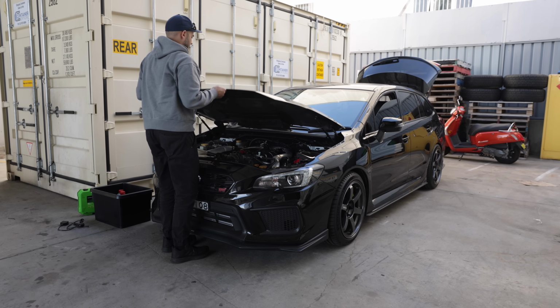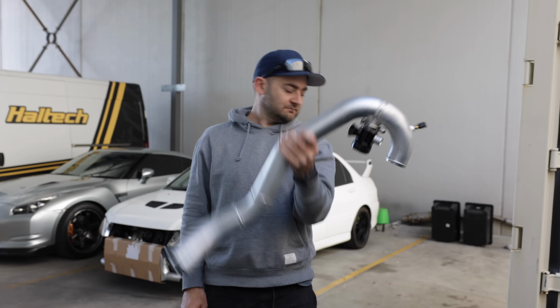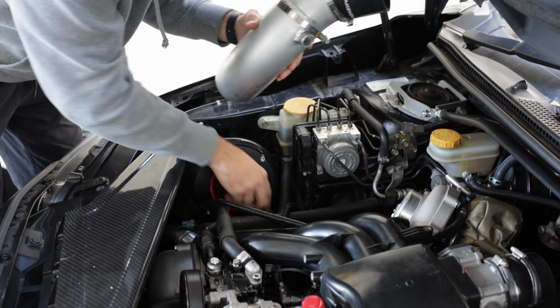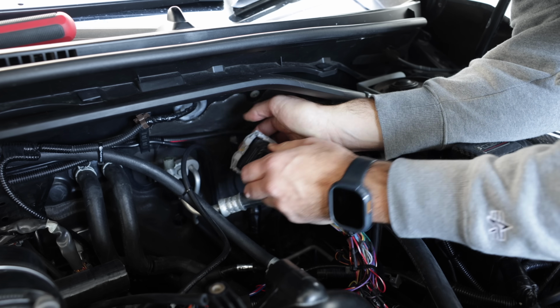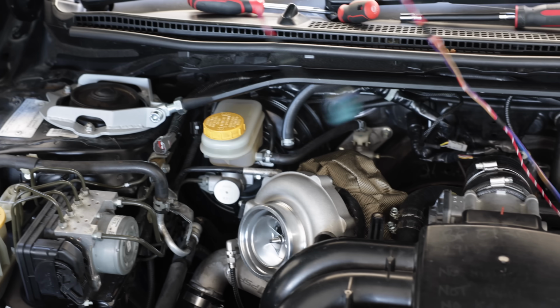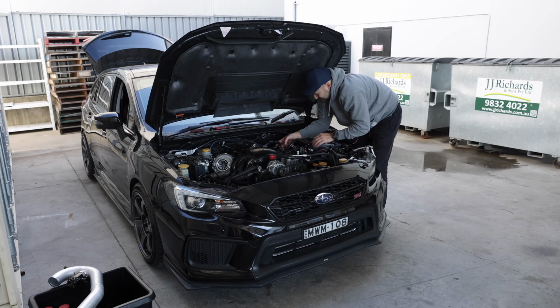The car behaved perfectly. Didn't get hot, didn't get cranky, added some ethanol. Now we continue the work. We've decided to leave wrapping the wiring loom until last, so that troubleshooting is that little bit easier. Everything appears to be working as it should, so now I can pull off the intercooler pipes, the intake and some other bits and pieces to extract the wiring loom. Once it's out, Dave and I can set up on a table and lock in where all the plugs of the harness need to end up, wrapping it in loom tube and oil and heat resistant engine bay friendly tape.